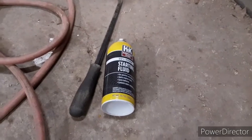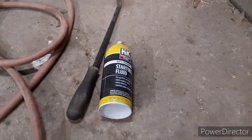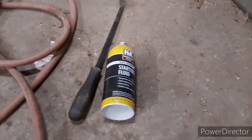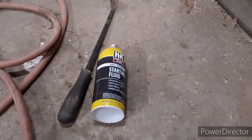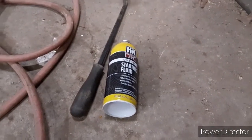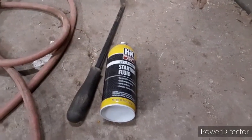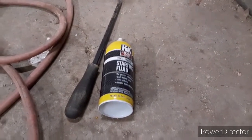But usually this is a last resort. It's not the safest way in the world, but usually I tried, you know, the ratchet straps or, you know, air blast, bead blaster, whatever. But you get these tires right here, high volume. They're 75 profiles. So there's a lot of room in there, and they would not go unless you did exactly this. I tried come along ratchet straps, tire bands, bead blaster. This was the only way, and that's what I had to turn to.